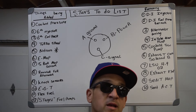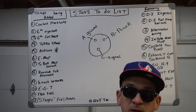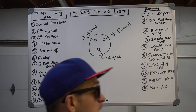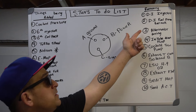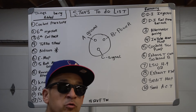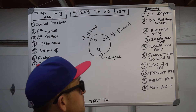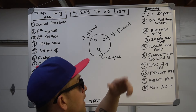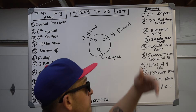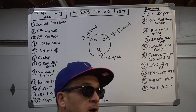George will do the installation and I'll show you guys the wiring — we're not going to run all three pumps at all times, but I'll show how the ECU controls all three. Now for what we're removing: DI injection fuel pressure — the R32 motor doesn't run that, it's something newer motors like the RS3 have. Also removing: alternator wiring, intake manifold flap, coolant switch pump — all things we no longer have. The coolant switch pump was necessary on the RS3 because it has three radiators.